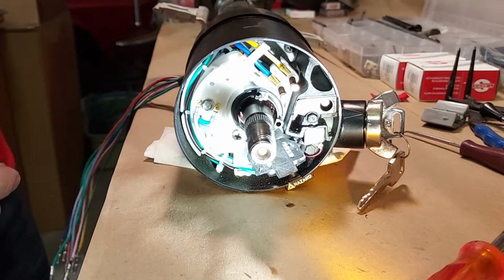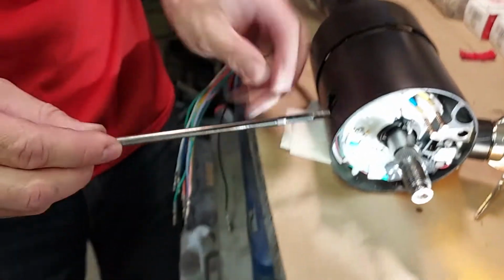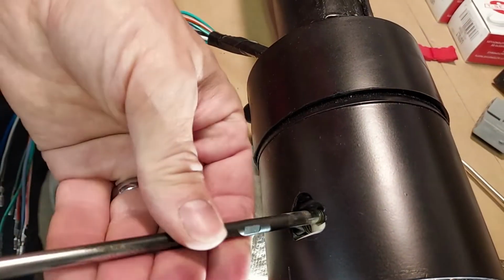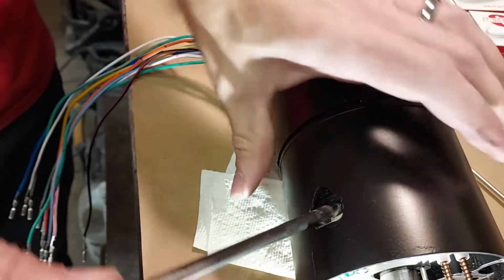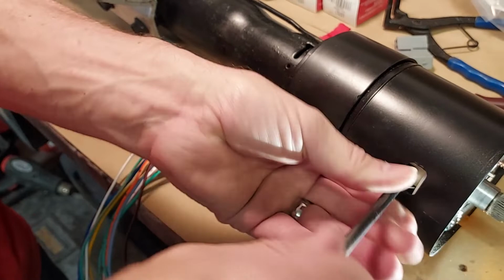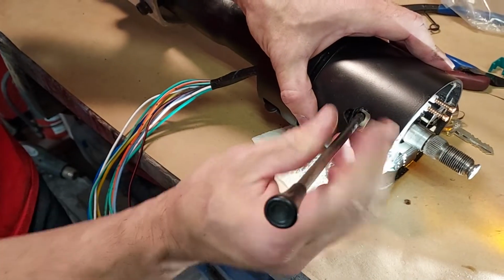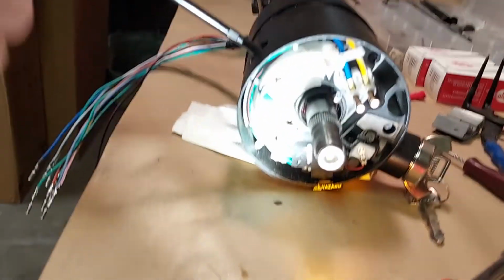Okay, now that turn signal switch is in. Let's test it. This turn signal stock goes in at a slight angle. There's a lever right here that actuates the tilt, so you have to move that out of the way and kind of find the threads. It's a little bit of an angle. Don't want to strip it either. There it is. Just got to be patient and try to find the right angle for that, because it is a little bit of a weird angle.